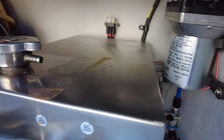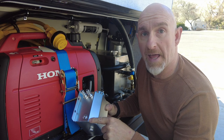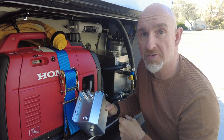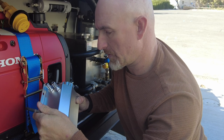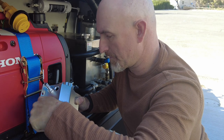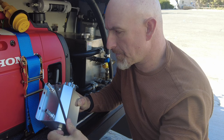You can see here where the coolant's been leaking out of the coolant reservoir. I'm going to move this nozzle to the bottom of the catch can so the coolant can come in and drain out of the bottom as it needs to. Make sure to tighten these fittings up because they came loose from the factory.